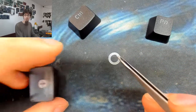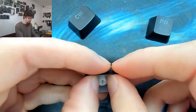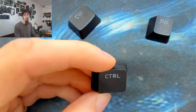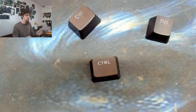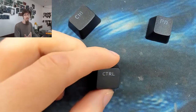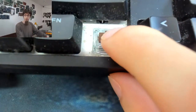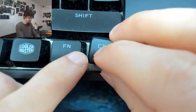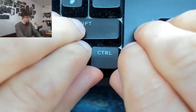O-rings don't make your keyboard silent - mechanical keyboards are noisy unless you completely relearn how to type. The reason keycaps make noise is what's known as 'bottoming out' - when the key goes all the way down and the keycap slams onto the keyboard, you get that distinctive clack noise. The O-ring dampens that slightly.